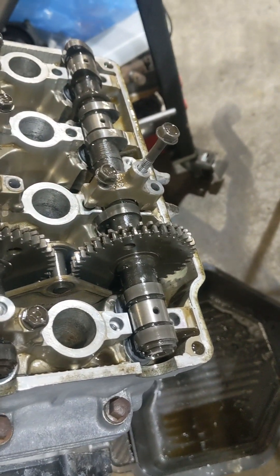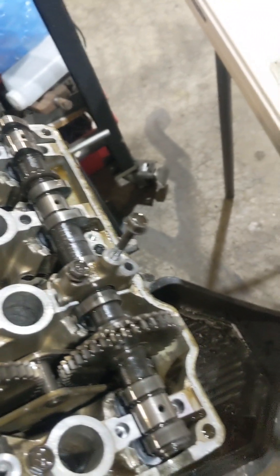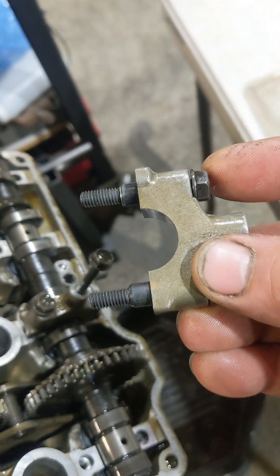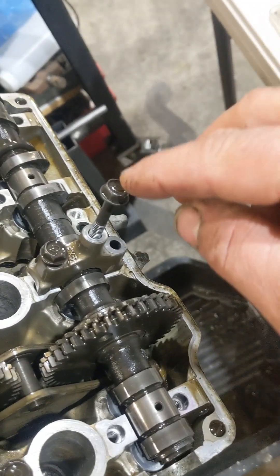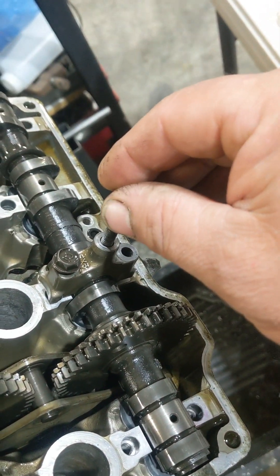This cam is quite stuck. They get stuck in the metal dowels that go into the head, and the pop method didn't really work that well. So I've had to put a bolt where the rocker cover goes in so I can wiggle it out.